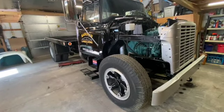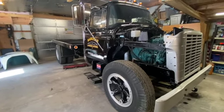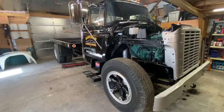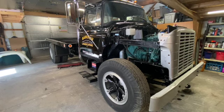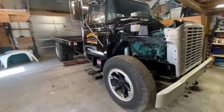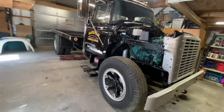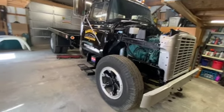had been converted to a church bus, which just means painted poorly. But it was an 88 International S-Series with a Thomas-built body on it. Just your standard 66 passenger, not the long 72, but just the regular old 66. And it had Daytons with 22.5s and actually a usable set of tires on it. This bus was on the road as of 3 years ago. It's probably only 40% tread on the drives and a little better on the steers, but they're not weather checked. They all hold air. They're good usable tires for the time being.